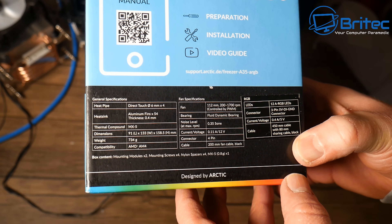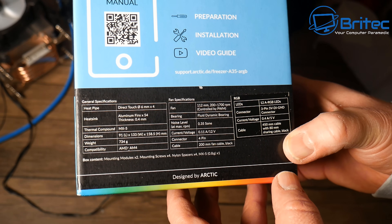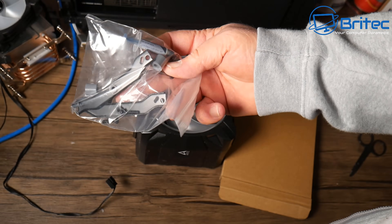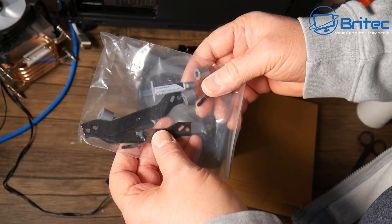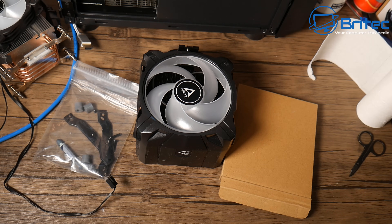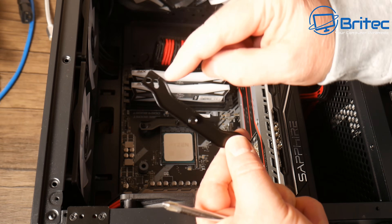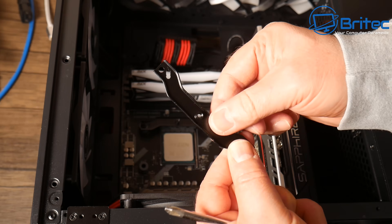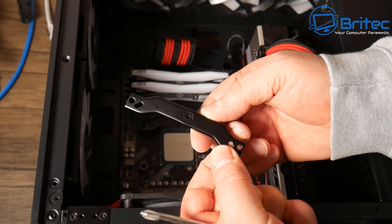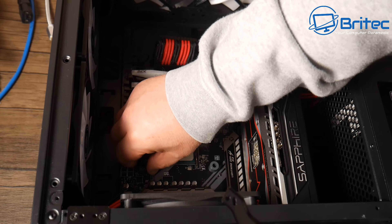The fan is actually a 112mm fan, not 120mm as I said earlier. It has a four-pin fan connector and speeds from 200 to 1700 RPM, controlled by PWM. Because this one is designed for AMD systems, it's got an AMD bracket and all your fixtures and fittings, plus Arctic MX-5 compound. This is an AM4 socket. You can mount this even with the motherboard in the case — use the last hole for AM4 and make sure the ridges are facing up.